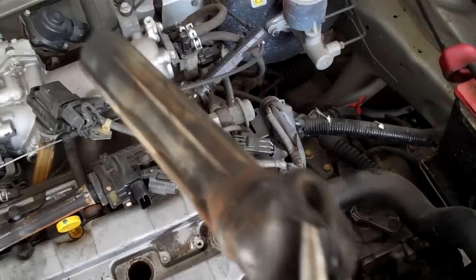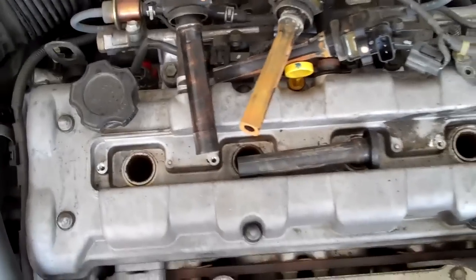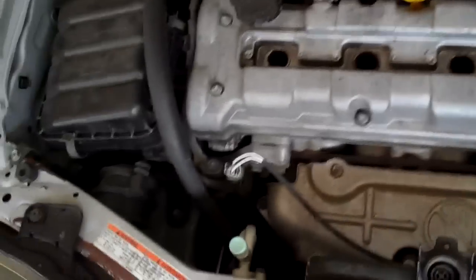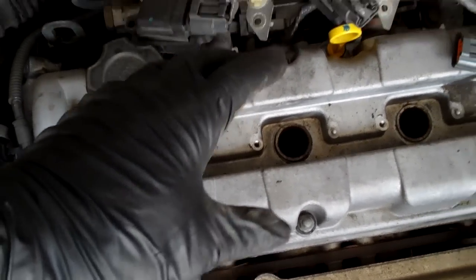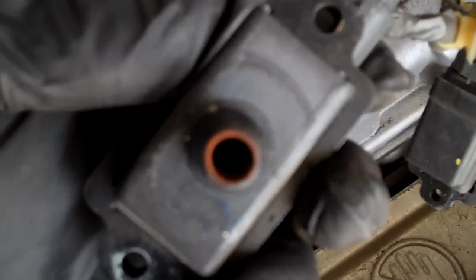This one ironically doesn't have near as much rust as its next-door neighbor — cylinder number three or cylinder number two. I pulled cylinder one to discover this, taped it up and cleaned it, but we still had an issue because we didn't replace the spark plugs. About to remedy that. Along the same lines of replacing the boots, as I got looking at each of these ignition coils, whenever you have moisture trapped in a confined space and then warmed, a lot of that moisture is going to turn to steam and go to the top.